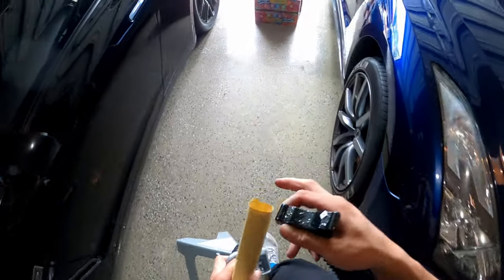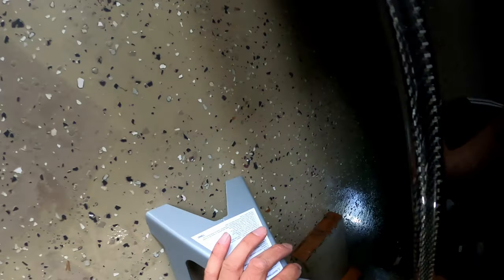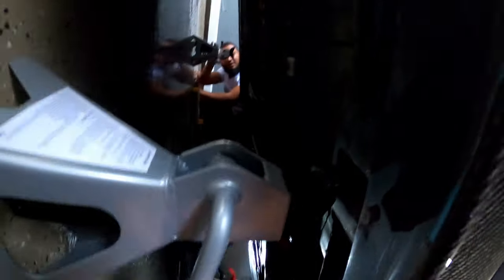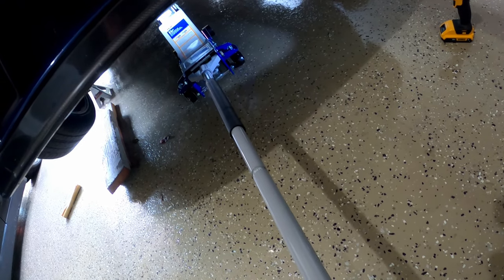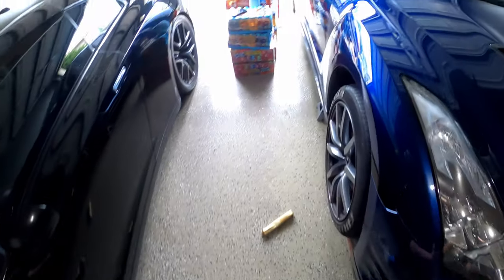Once we lifted up the car, make sure you put jack stands on the jack points. All right, do you see the little block thing? Yeah. There we go. Okay, we're gonna lower it. Lowering. Good? Yep. But we're gonna keep extra support. We're gonna keep this jack at the jack point, just minimum pressure. Okay, so we got three points of contact. Perfect.